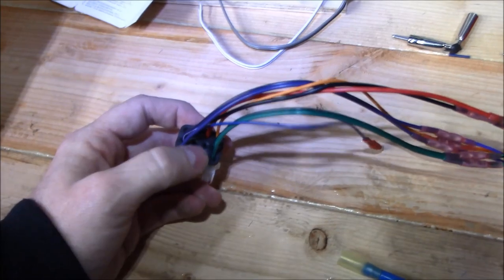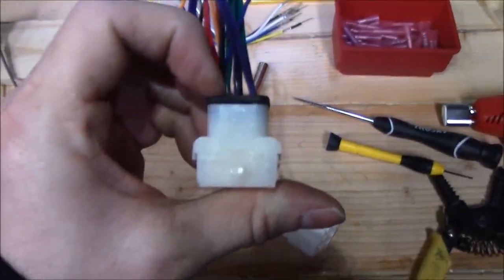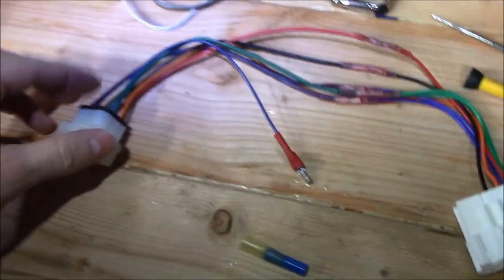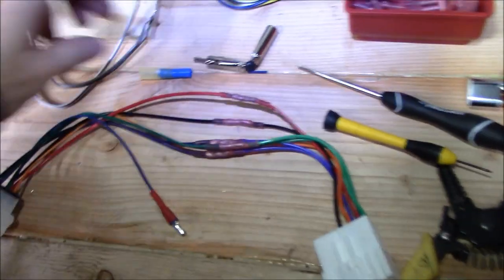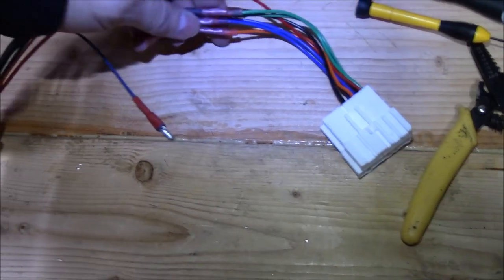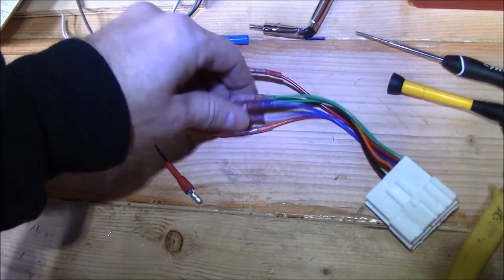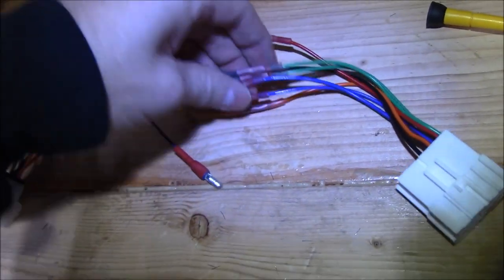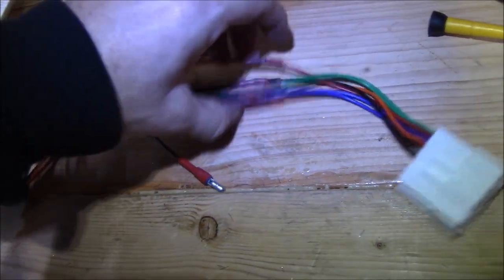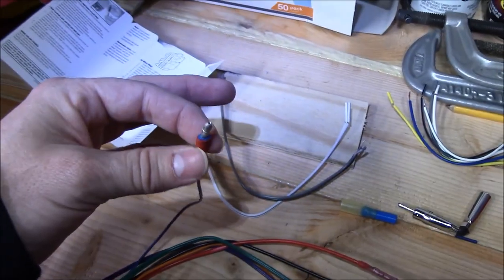There it is — my harness all done up. I was able to de-pin those wires nice and neat. Fought me a little bit; I tried a screwdriver first then a pick — the pick seemed to work better. I just ripped a couple out. The molex has a rubber gasket, which is pretty cool. I'm not sure how they seat it fully back in but I don't know that it really matters — I'm not in a boat, not expecting to get too wet.